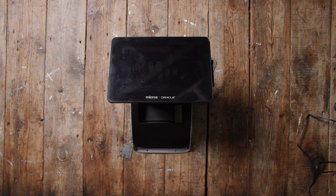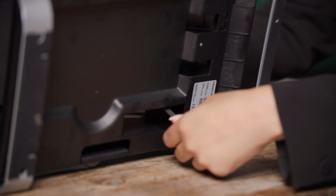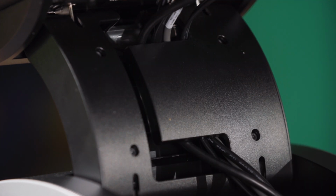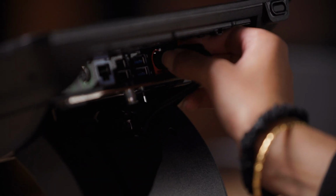Now let's plug your Workstation 3 power cord into the Workstation 3. To start, grab your Workstation 3 power cable, also fed through the back of the cash drawer. Tilt the workstation stand over carefully and feed the power cord through the base of the workstation and out the neck. Weave it through the cable management tool to minimize the appearance of cabling once done. Next, plug the Workstation 3 power cord into the back of the Workstation 3.